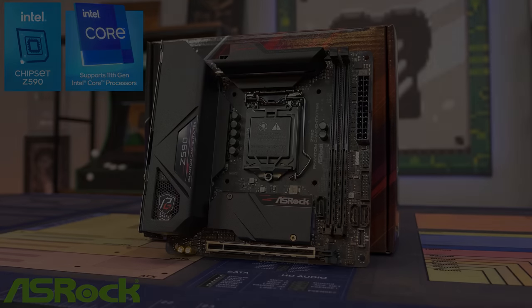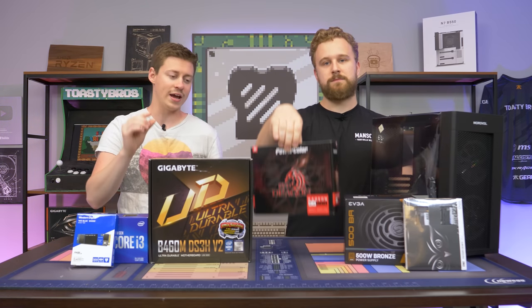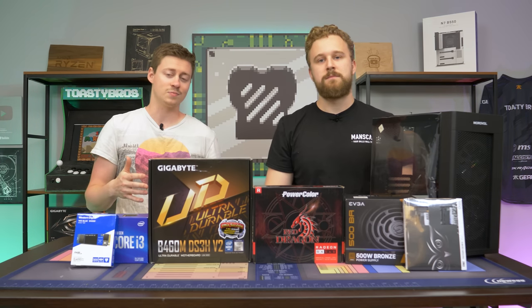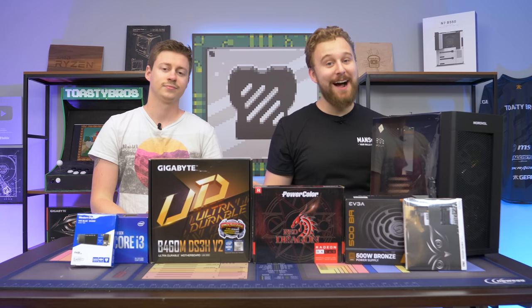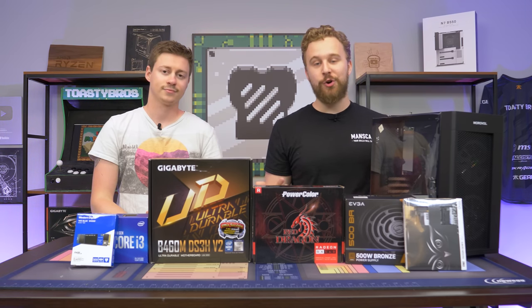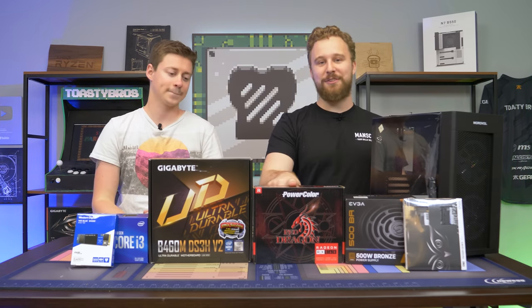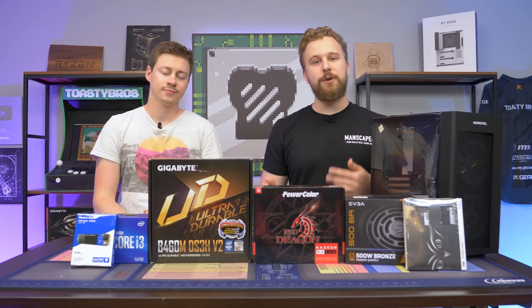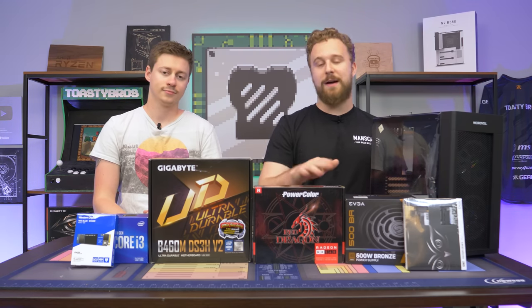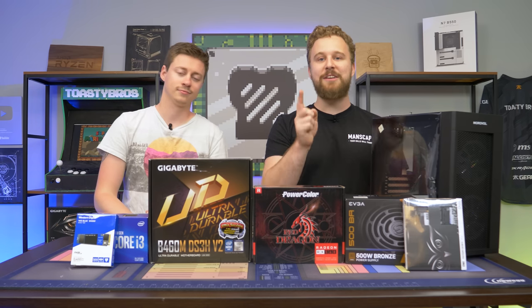Check the link down below to learn more. We'll have links in the description where you can get all these parts. The only thing you might have a little trouble finding is the RX 560 — specifically at the right price. You'll find them on eBay but some are going to be $300 plus; we recommend spending $200 or less. At the beginning of the year we did a $500 build with a 570 and the same CPU, and now this is a $600 build with a lesser GPU, which shows the market isn't great. But if this performs better than an APU like the 3200G or 3400G, you can upgrade the graphics card when the market improves and have a great basis for a gaming PC.